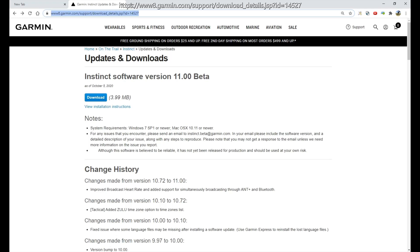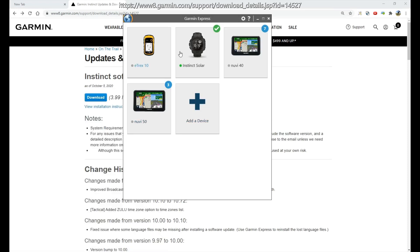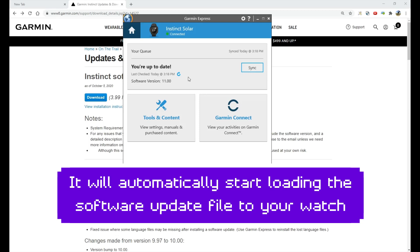The other thing you can do is download an application called Garmin Express. When you go into Garmin Express, you can load in all of your Garmin devices — in my case I've got an eTrex, my solar Instinct, and a couple of different navigation Garmins. You can click on your Instinct, plug your watch into the computer so it can read it, and it'll tell you whether or not you've got an update to do. You'll see in my case it says I'm up to date and shows the software version — the reason is because the minute you plug it in, it will automatically start doing the update. So if you don't want to get the update, don't plug your watch into your computer. But you can open Garmin Express and it'll tell you whether or not there's an update, and the minute you plug in your watch with Garmin Express open, it's going to automatically start doing that update for you.